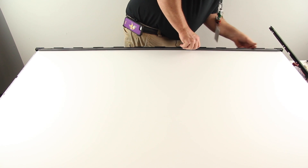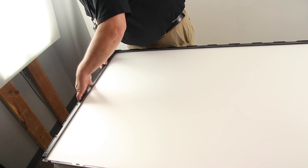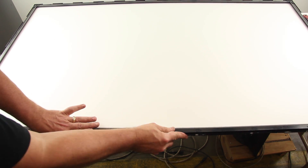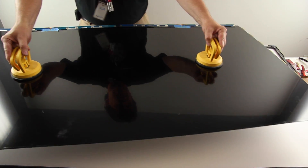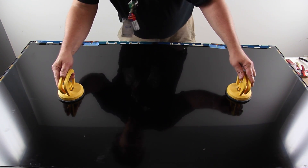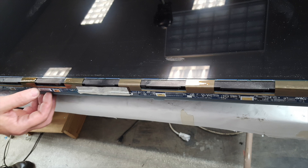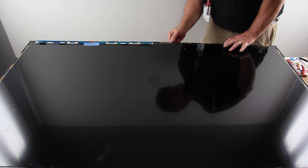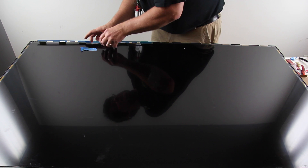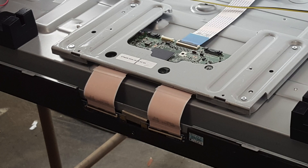Reinstall the panel frame. Reinstall the panel. Release the scan drive boards and secure them into position on the clips. Reconnect the ribbon cables to the scan drive boards.